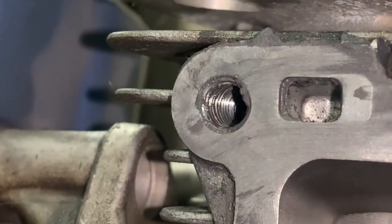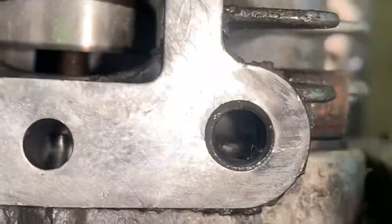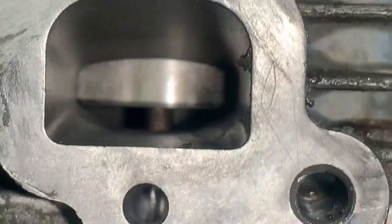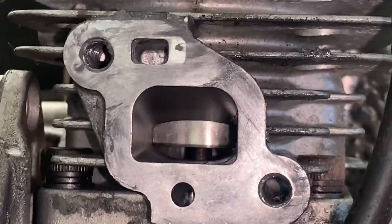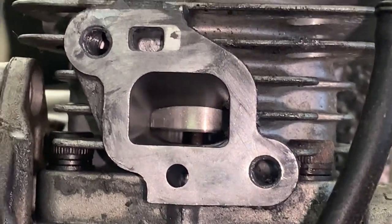Come in and inspect the engine mounting holes and the threads — these look okay. The piston's not scored on the intake side, so we should be able to put this back together with a new gasket and Loctite on the screws, and be good to go.